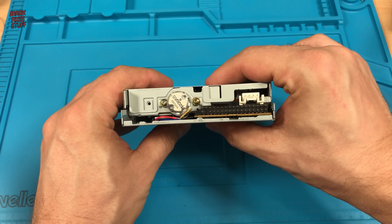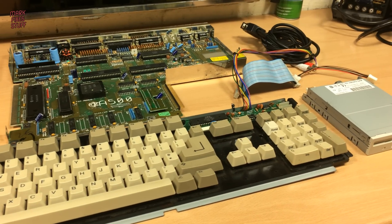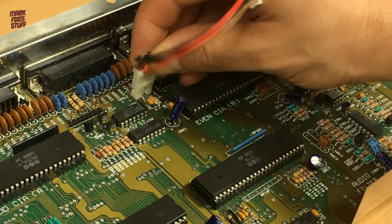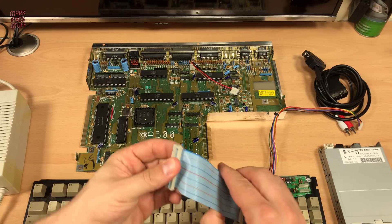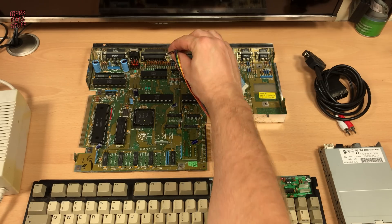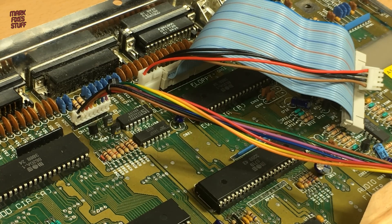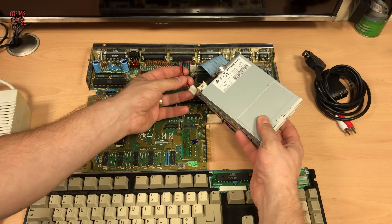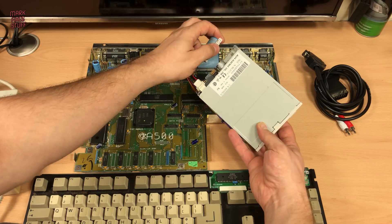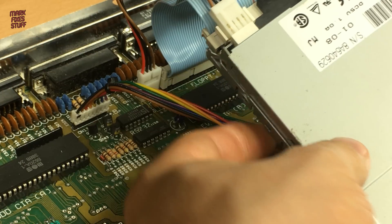And there's that classic rear view - you sexy beast. We're back once again at the Stunt Amiga A500; it's in a few pieces as you can see, but we can pop it back together fairly quickly. Power for the drive. Data for the drive. Keyboard - very important. And the drive itself. You have to lift these up to put them on. When replacing the drive cable, make sure that you put pin 1 to pin 1, usually indicated by the blue stripe.